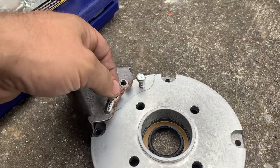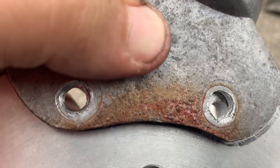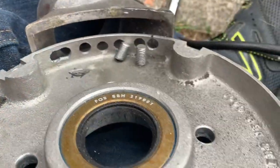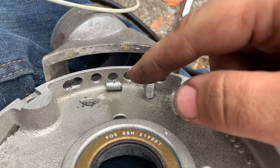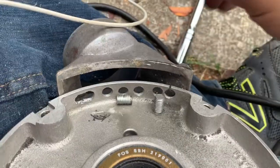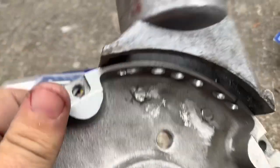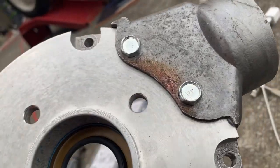Apparently these holes are too small for these bolts. I was trying to drill the holes a little bigger, and this liner gasket on the inside came out — now I can't get it to line up with the hole; there's too much space. It was still hot — I started to mark the bolt up on the edge and I think I actually just burnt myself. I realized I wasn't going to be able to pull out the bolt and see the markings, and it was going to be difficult to cut once I did pull it out. So I just took the Dremel tool and cut down while it was actually in there. That's the finished piece — the bolts are at the proper length, threaded, and the right size.